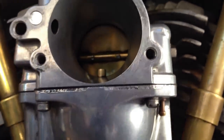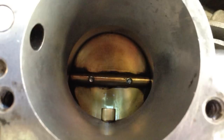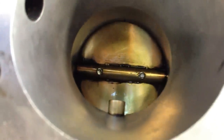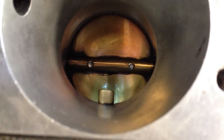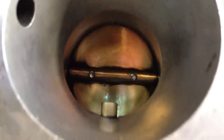Now Jerry, close in a little bit closer again. The accelerator pump is wide open to allow gas to squirt in, and I have to close the throttle myself by finger. When I twist the throttle, I get a squirt of gas, but the throttle plate doesn't shut all the way — I have to put my finger in to close the throttle plate. The throttle plate only closes properly when the accelerator pump is turned all the way off. Now the accelerator pump is closed, and the throttle plate shuts perfectly — when I put my finger in, it will not move any further. But of course there's no gas from the accelerator pump.